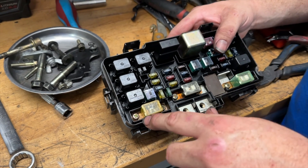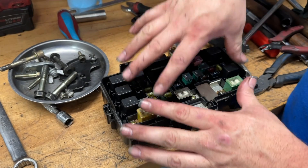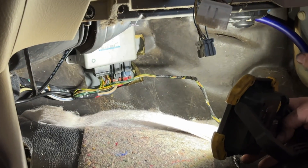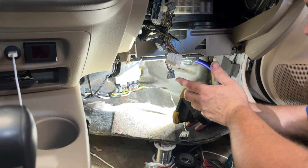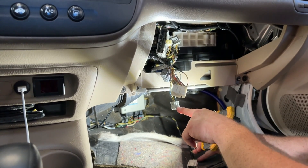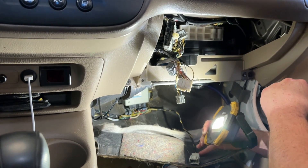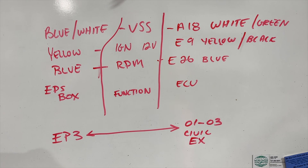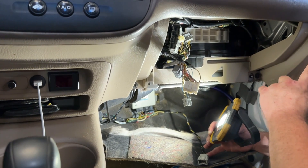The only thing you'll have to add: there's a little square nut that goes underneath the fuse holder — it'll actually snap into the factory fuse holder, so you take the whole thing apart, push the nut in, snap it back together, then put the screw in with a wire on the bottom. I put nut-serts in where there was a hole in the floor, so it looks like it belongs. Everything else is plugged in; the ground is over here in the center, and I'm adding this plug to the ECU wires to get the proper signals for the box.